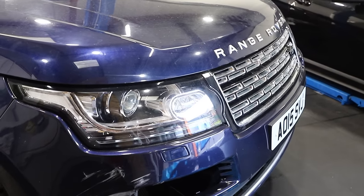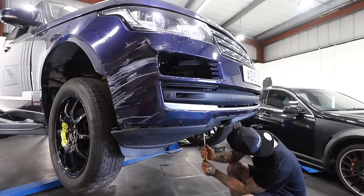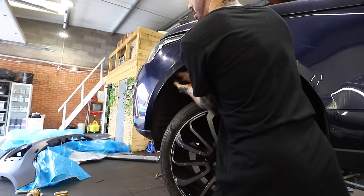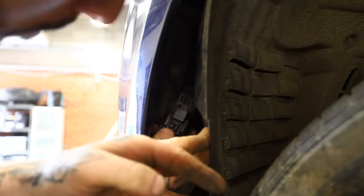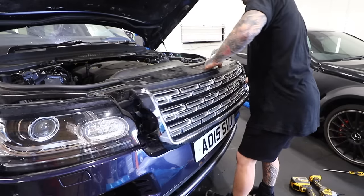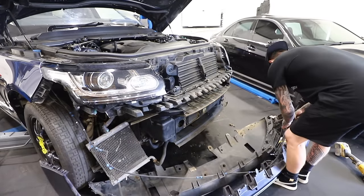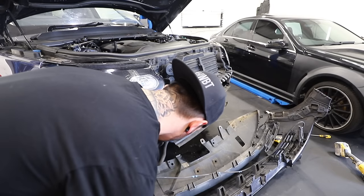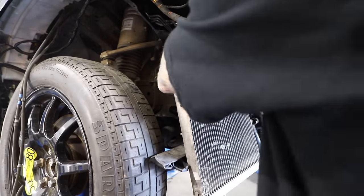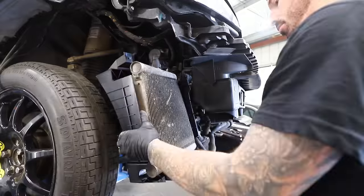To facelift the Range Rover we need to change the headlights - my worst nightmare. But before we even start attacking the headlights we've got to get off the damaged parts, and a few bolts were a little difficult so you can see me angle grinding them off. I've got to remove the front bumper which was a pretty easy job. I'm just hoping there's no damage behind the bumper that I didn't expect. There's a few bolts on the top of the grille that need to be removed, and once the grille is removed there's a load of 8mm bolts on the bumper. Once they're undone I can pull the bumper away from the car, disconnecting the electrical connectors, the parking sensors and the headlight washers. Luckily the only damage was the front lower radiator bracket which was shattered to pieces, but here's the new bracket donated from a subscriber, so thanks so much for that.